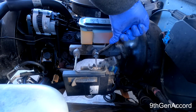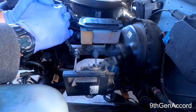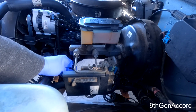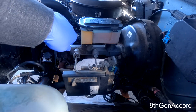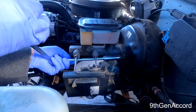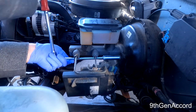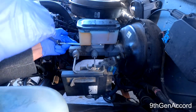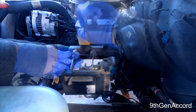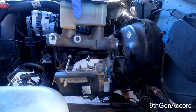Taking the lines loose first — there's a nine-sixteenths head on both sides. Please use a line wrench when you do this. I've got an absorbent pad underneath to catch the brake fluid that's going to dribble out. Using a 15-millimeter deep-wall socket with an extension, we loosen the master cylinder. Once that's loose, move the dump valve assembly down and there's our master cylinder.